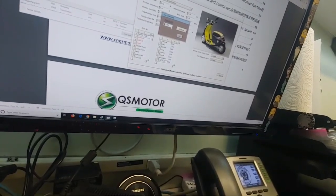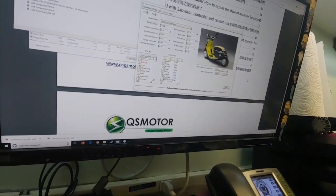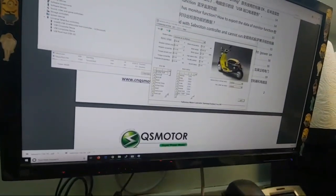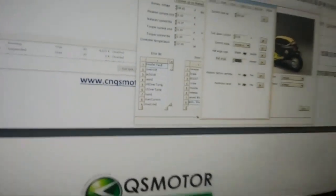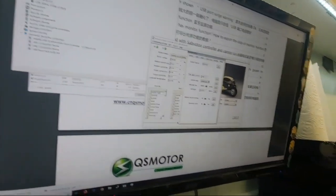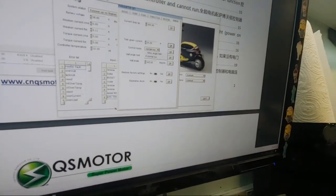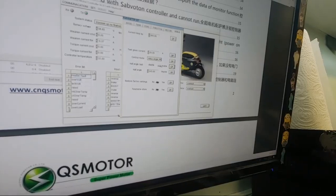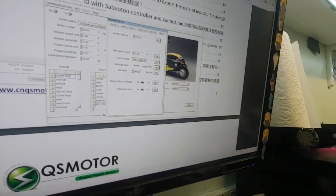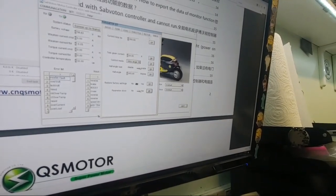That costs extra. Go to COM3, configure. 58 volts. Go set, debug. It's back to normal run. It never saved my setting. We try again. 20. We go 20. Okay. Control mode, Hall angle. Okay. Hall angle test. Okay. Parameter store. Okay. Parameter store. Click mofo.